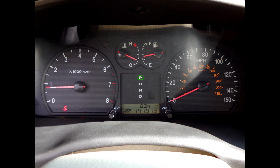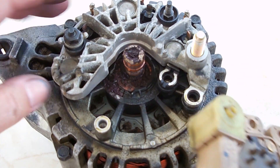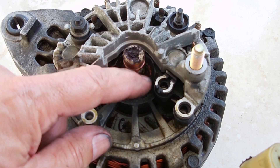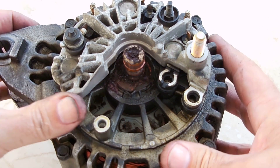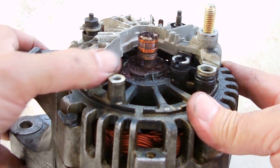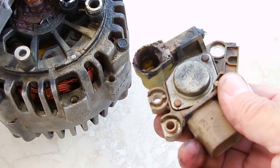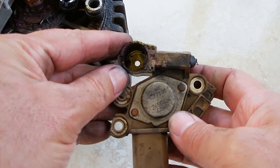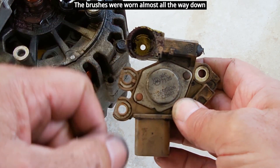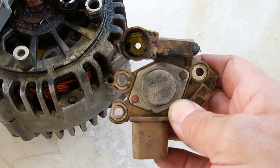Let's take a look at the old alternator. Let's pop up the voltage regulator — it came up very easily. What a mess — you can see all this crud underneath. I did have a little bit of an oil leak; I tightened the valve cover since, but it looks like the oil found its way in by the brushes and mixed with the dust created from the brushes as they wear down. If you look inside the voltage regulator, you can see the brushes are all the way in, so there was definitely no contact being made with the slip rings on the rotor — and that's why power was not being generated.